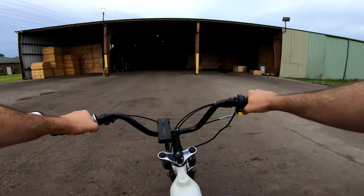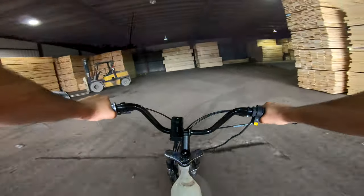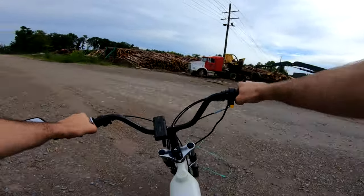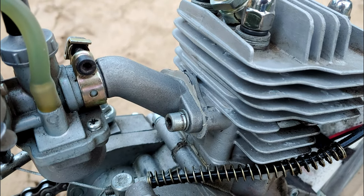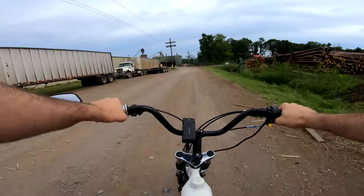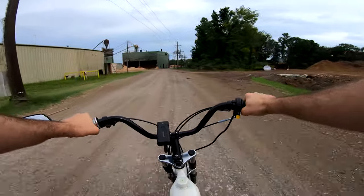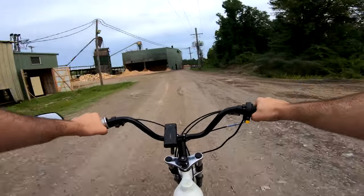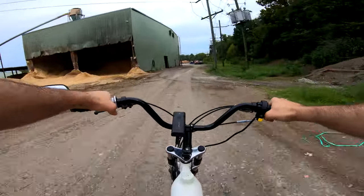As far as adapting a standard 40mm intake to this piston, well, it was just plug and play. I will point out that the large intake port just barely has enough meat on it to seal on a 40mm intake for a standard China Doll or YD100. So I added a gasket and a decent amount of sealer. It seems to be working because the motor doesn't appear to have any air leaks, has a perfect idle and good throttle response.